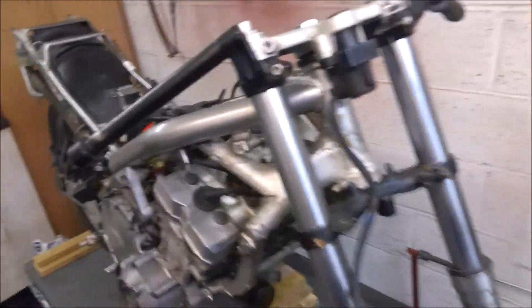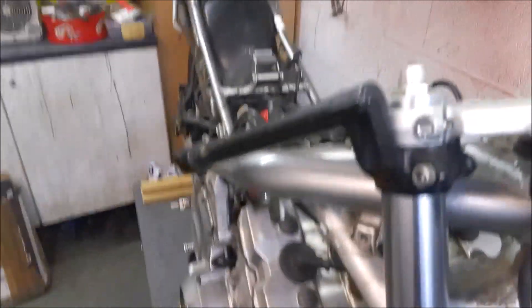The top yoke bolts in using the standard head bearings, and you can see the ignition barrel all mounted in — again, just a straightforward swap. Not everything lines up though — it just seems to rub on this little bracket up here, so I'm just going to relieve that a little bit with a file or the angle grinder. The only downside is the Fireblade clip-ons really don't work, they're just that bit too close. You could file off the locating lugs and pull them round, but I think they're going to be a bit too low to be properly comfortable, so let's start looking at the rest of the braking system.